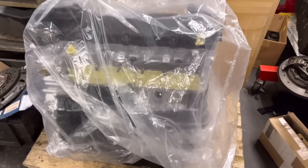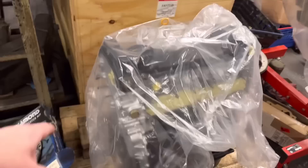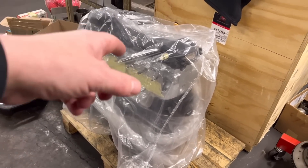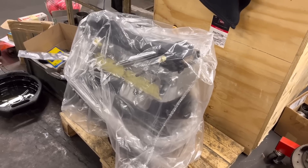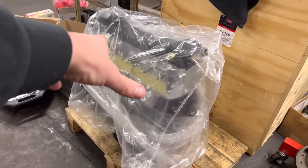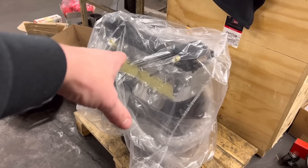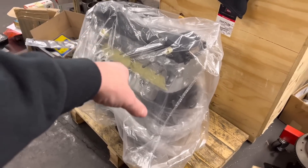So the VR6 engine - Paul has had the gauge on this today. We've filled it with running-in oil and turned it over with our big drill, which turns it over at about 300 RPM. This thing's fetching near enough five bar of oil pressure, which is more than adequate. The oil pressure relief valve will open at five bar. At that speed it's absolutely perfect - I'd expect with hot oil on idle it would be about three bar. So no worries there at all.